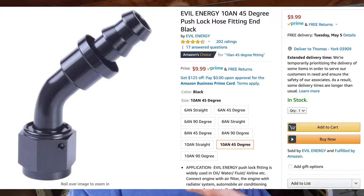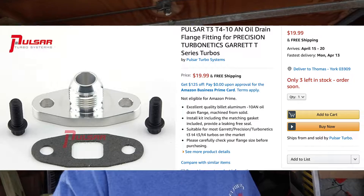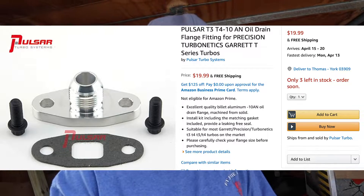I put the 90-degree fitting on the turbo end and the straight end on the block side. For the oil drain, you're going to want to get two 10AN 45-degree fittings — I used the push-on style because it was easiest. You can do AN fittings if you want, but just make sure they are full flow if you get the push-on style. You also want to get two 10AN oil return flanges. They run about $20 each, and you need two of them — one for the block side and one for the turbo side. It uses a 5/8ths or 16mm barb oil drain hose; I got one that was about 45 centimeters from Amazon.